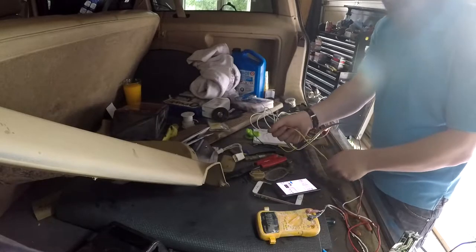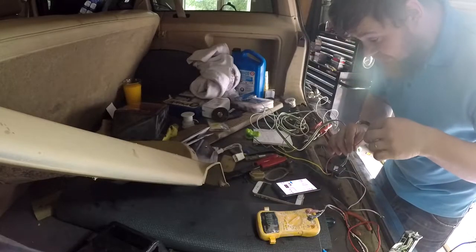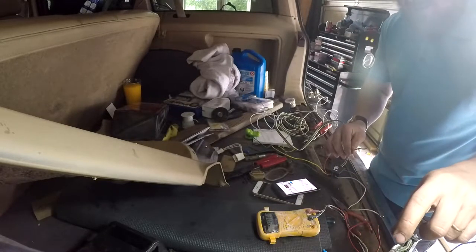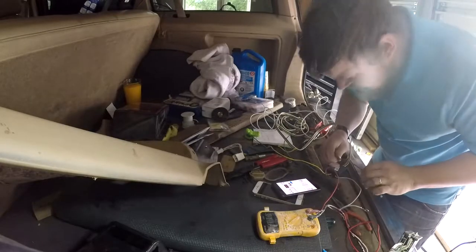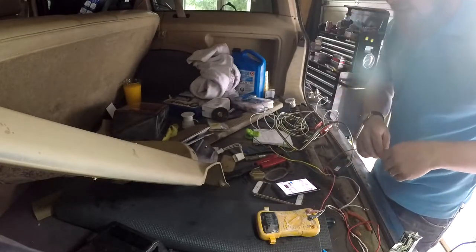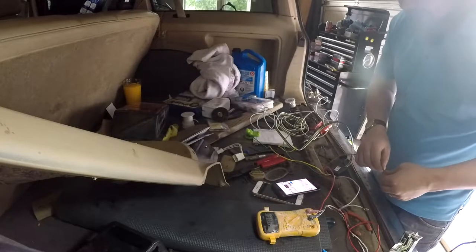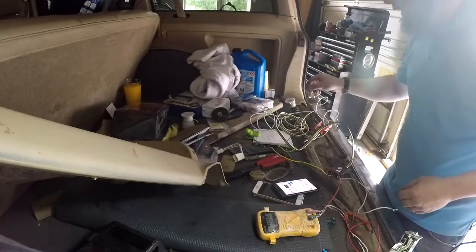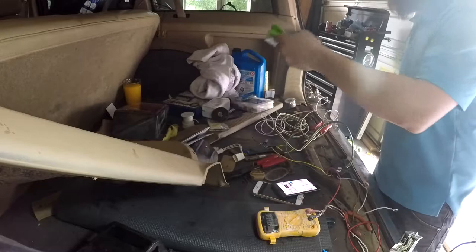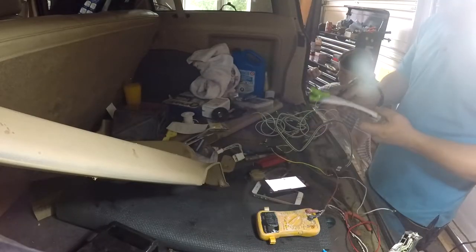Turn signal, boom. Okay, so stop is the red wire, which is the white. And then brown is the tail light, so the daytime running light or the night lights. So that's cool. And then we have our ground. All right, so now we know. So we're going to write that down so when I edit the video later, we know what's what. So there we go. Now we have it all, and then white to ground.